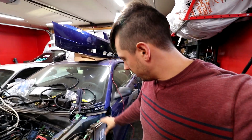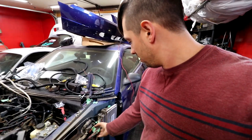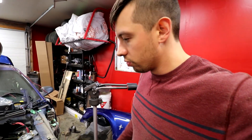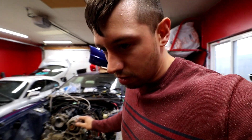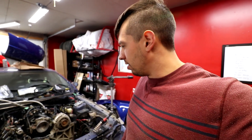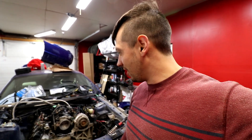That's where I'm going to stop today. We did get the ECU mounted, got a lot of the wiring started. I need to order some one-inch loom for the bigger sections - the three-quarter inch stuff wasn't really big enough. Still have to put loom on those sections and wire up some grounds. Oh, I just realized I'm missing an alternator plug - that's probably what this connector was. It's a one-wire alternator plug, so that needs to be wired in. Anyways, I'm glad you guys stopped by - make sure to hit that thumbs up. I have three night shifts now so I was out here while I should be sleeping. Thanks guys, appreciate it, love you guys.